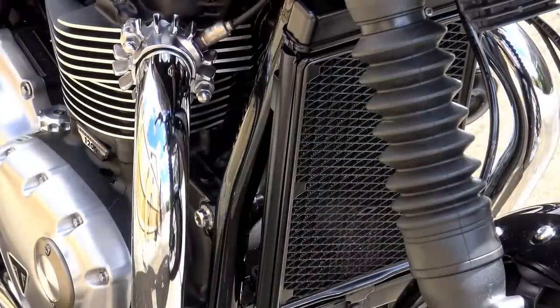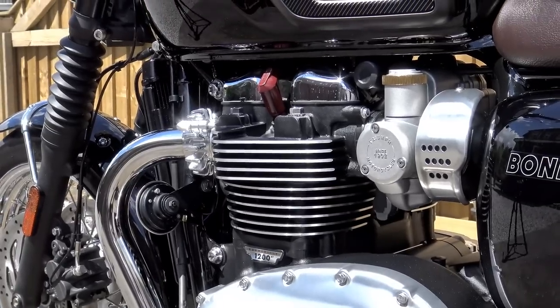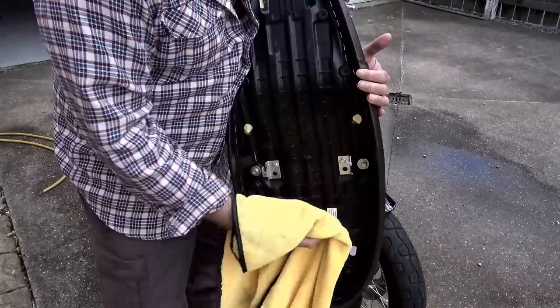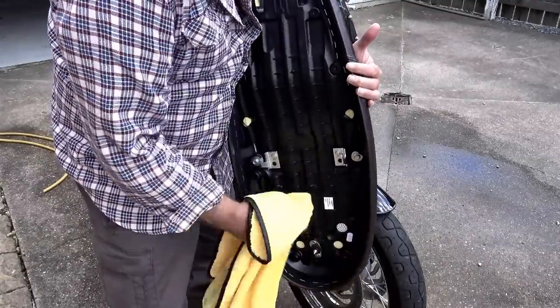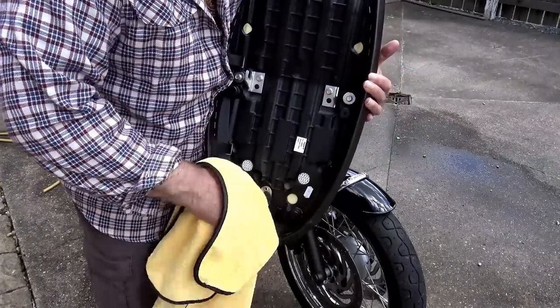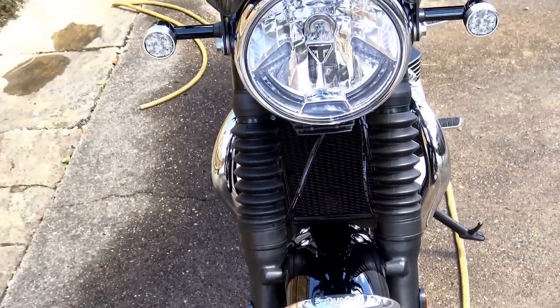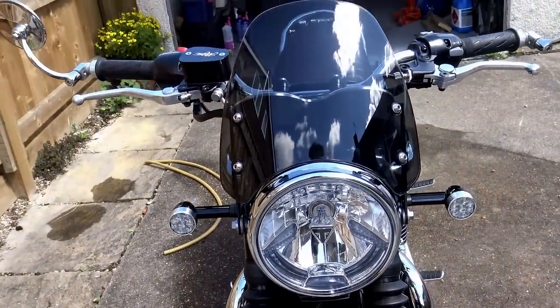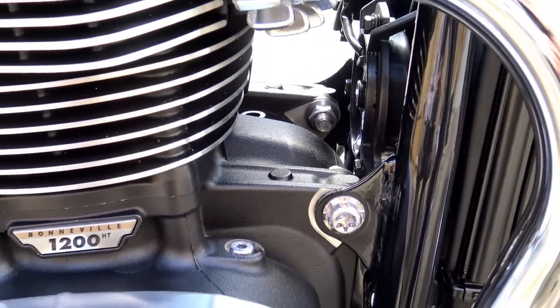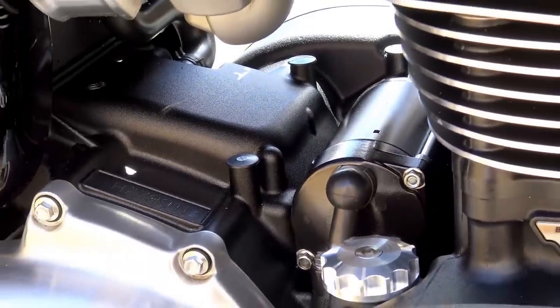Once you're confident you've got it as dry as you can — not forgetting to remove the seat and dry underneath including the underside of the seat pan — follow Triumph's instructions in the owner's manual: start the engine and leave it running for five or six minutes to get it hot and circulate warm air around the bike. On the T120, at the top centre of each throttle body there's a recessed screw that fills up with water — wick it out with kitchen roll and spray a little GT85 in there.